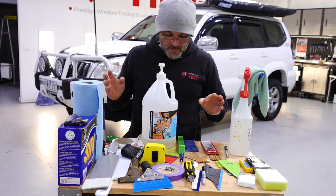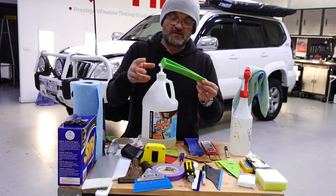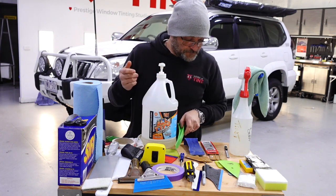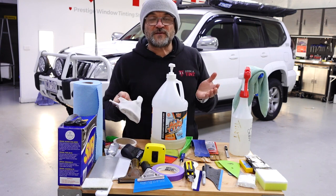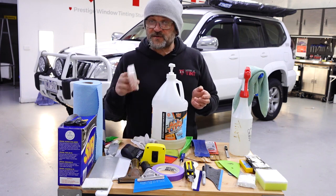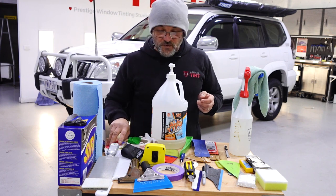For removing door trims, you've probably seen these pry tools — they are very handy. I've recently got myself one of these trim tools and I also use it for cleaning side channels: you pop a rag around it and clean the side channels with that, so it's very useful. When shrinking, I dry shrink a lot — mainly dry shrink with rear screens — and I'll always use a glove as well. We'll teach you how to use a glove and heat gun efficiently. You also need some wind-up tape: once you've finished your job, put wind-up tape on the window switches so customers don't wind them down for a couple of days.